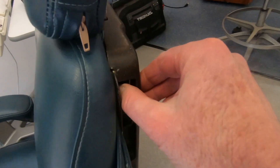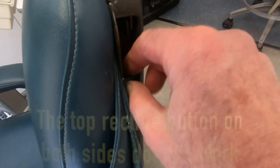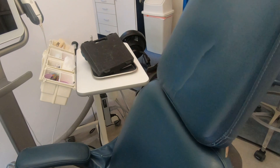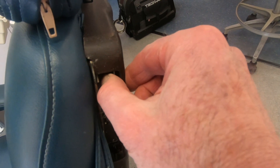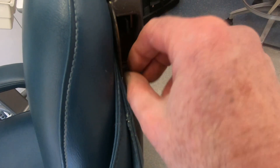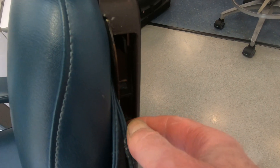The back doesn't work, but when I push the toggle switches on the left and right hand side backwards, either side, the chair doesn't go backwards. I ran a temporary wire from the switch all the way to the board by the foot part of the chair and it actually worked. So somewhere the wire is messed up between the back of the chair and the front.